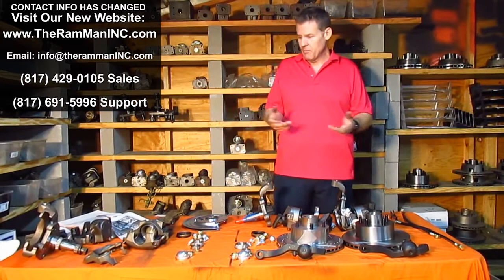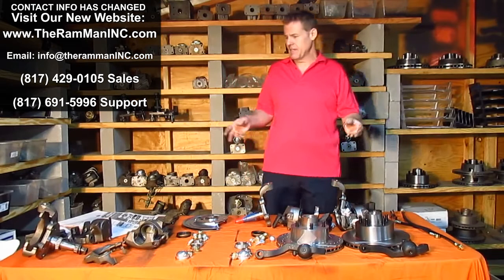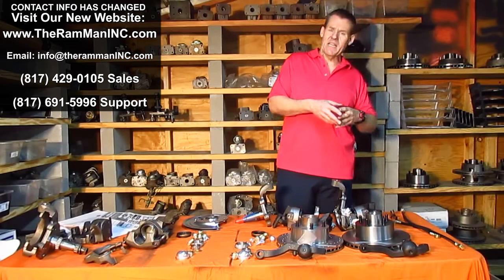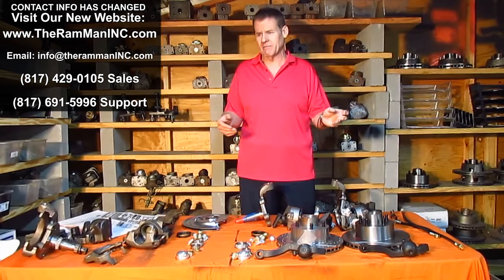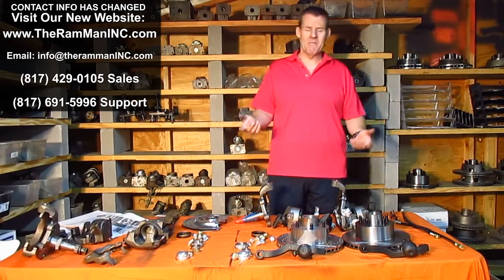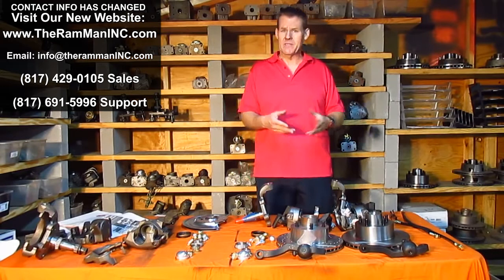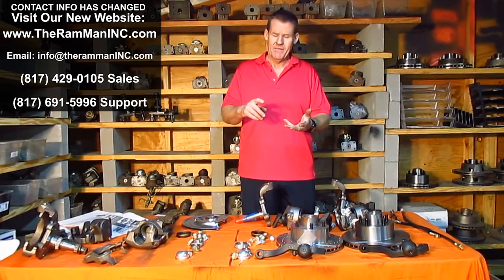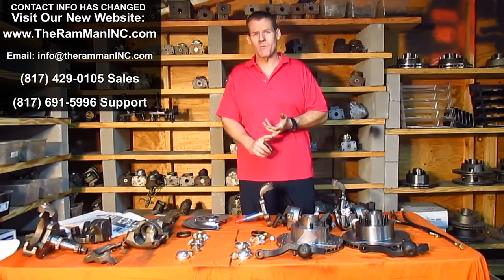That's what makes it wonderful for our older A bodies and B bodies — you don't have to do a wheel swap. When you look at these other aftermarket component people — engineered components, SSBC, Master Power Brakes — some of them tell you that you have to run 15-inch wheels because they just hodgepodged some gear together. Some of them tell you they don't know if your wheels will fit, period — that's up to your discretion. I can't imagine somebody spending $1,000 or $1,400 on one of their kits and being told 'good luck on the wheels.' These factory components were designed to run with a 14-inch wheel, so whenever you run factory components, you're never going to have any problems. They're going to look right, fit right, and work right because they worked on tens of thousands of cars.